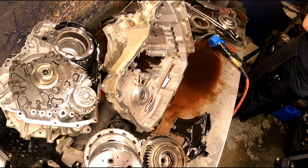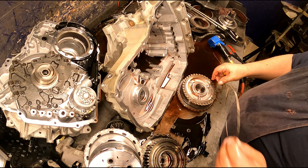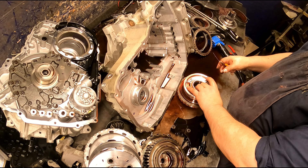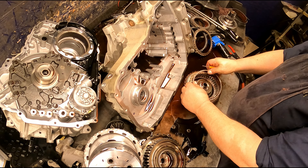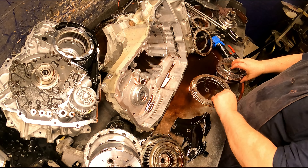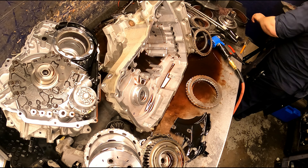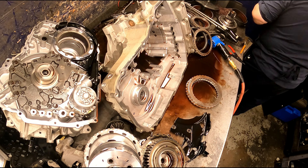In the back there is a small snap ring that'll allow you to get your input shaft out. I usually let this sit and drain because fluid keeps you from being able to see that snap ring. This one came out real easy — not much fluid in the way. Keep that snap ring off to the side so you don't lose it. The hub looks okay. Usually you can't get this snap ring out right here unless it's worn real bad, without taking the piston out.